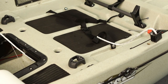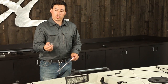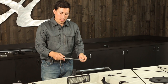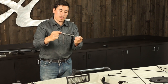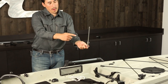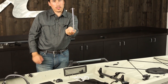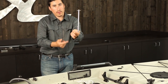Once the mount and base are on there, just pull your rope off. We're going to take those older parts from the first crank — the plastic washer and the spring — and slide them onto our new crank with the plastic washer going on first, and the spring with the smaller side facing downwards going on next. We're going to then push the crank up through the mount base, and once it's pushed all the way through, slide this pin through those holes to hold it in place. Then we're going to attach the lines to that rivet.